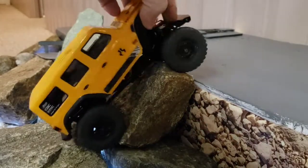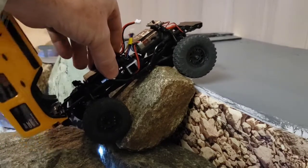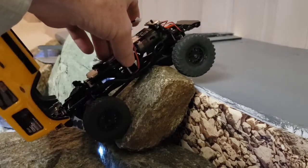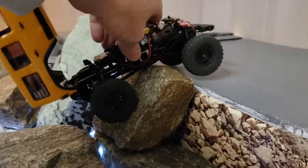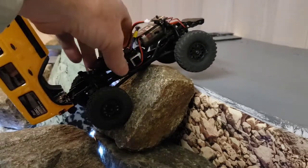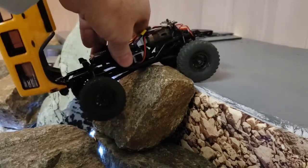All right, full stock. You can see that when this starts coming over, it'll hit right about here, and as soon as the frame hits, you're going to lighten either the front or back wheels. And in order to get over this, it has to be gunned, and it needs momentum to clear it, because the frame bottoms out, and as soon as that happens, you offload the weight from the tires. Also, in stock form, you can see this teeter-tottering where neither wheel is going to touch, and it just does not have the suspension droop to get the wheels back on the ground, well, for either side.